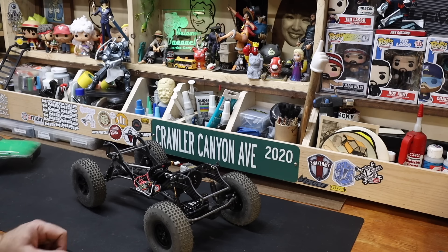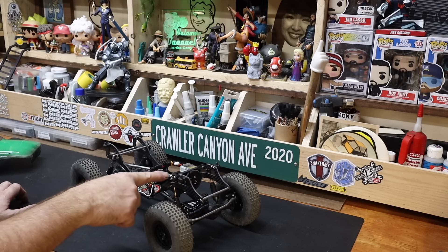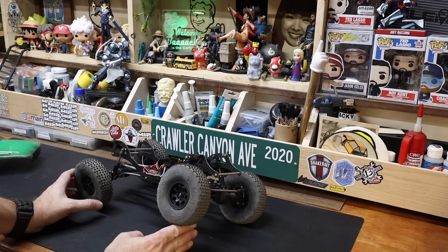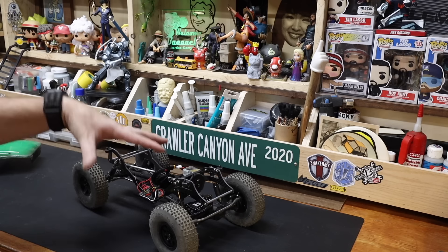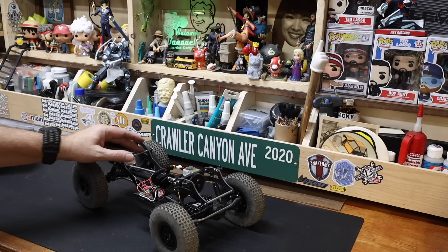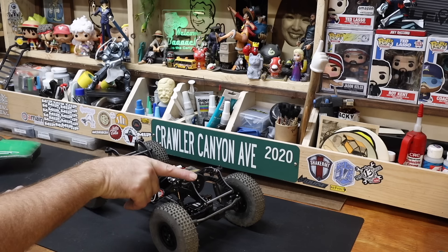Watch how much it settles — rear end kind of going down. I'm wondering about 0.4-pound springs in the front but moved up to the second hole; I don't know how that's going to impact flex. We've deliberately set this vehicle up to be lower flex because even in the last iteration at 2086 grams, when that weight starts to transfer, it will just fly away from you. I think these 4-gram braces were in last time, but maybe they weren't.